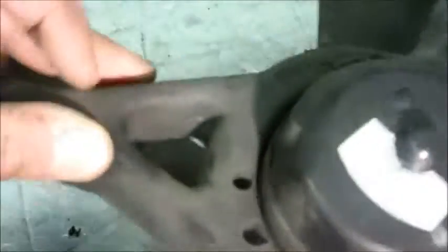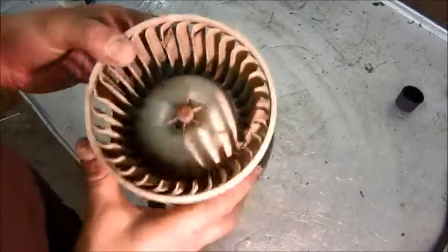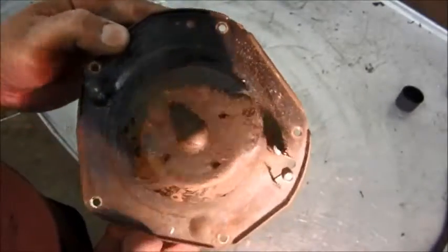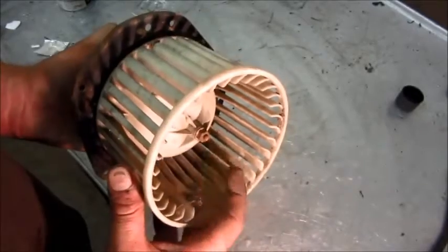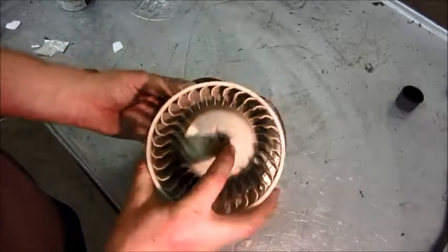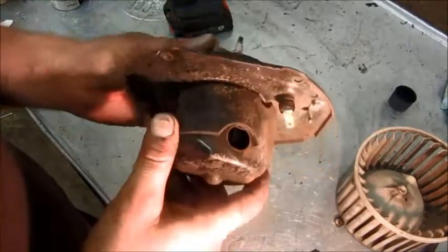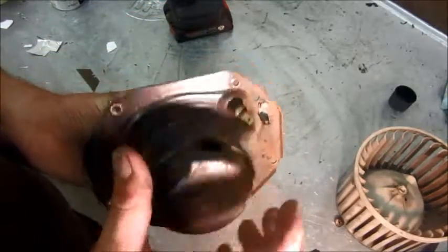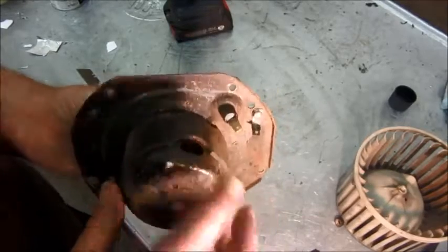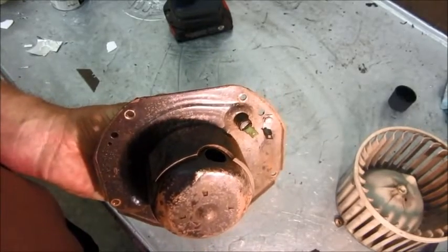I'm going to try to go through and oil this blower motor while I've got it out. It's the original Delco, 1984 spec. I'm concerned I may not be able to get the shaft nut off without destroying it, but if I get that off it'll be able to be oiled and saved. Now because this motor has a hole inside it and those vents, you've got to be real careful not to let metal chips go in there because the magnets will collect the chips and they'll stay in there and destroy the motor over time. So I'm going to tape that off before I try to drill it.